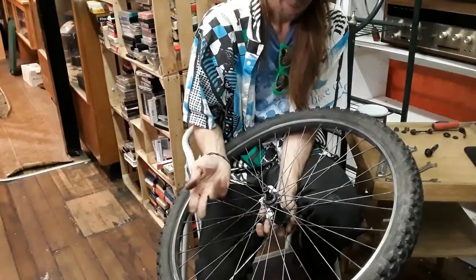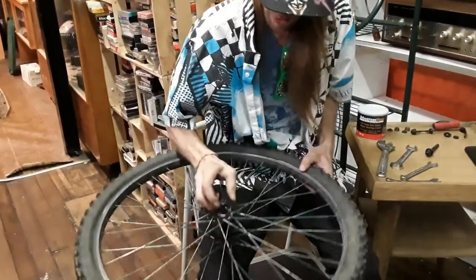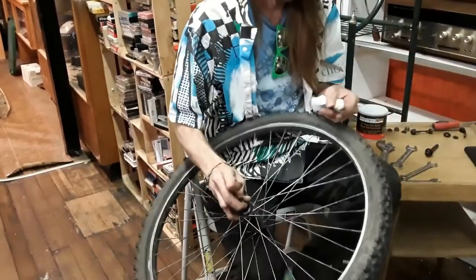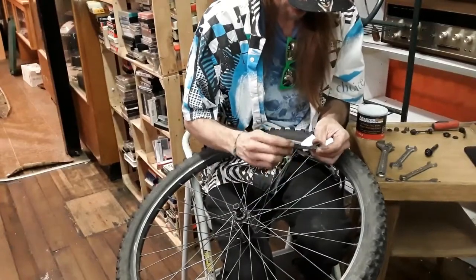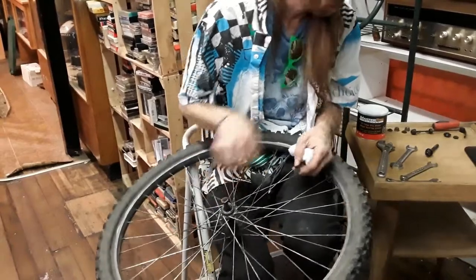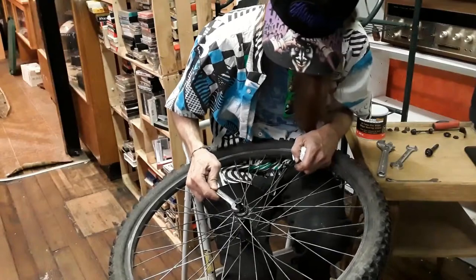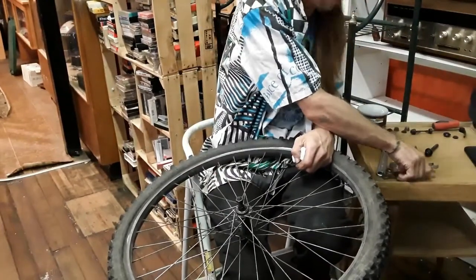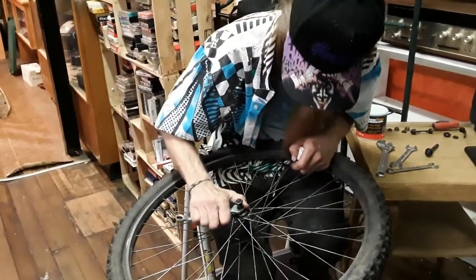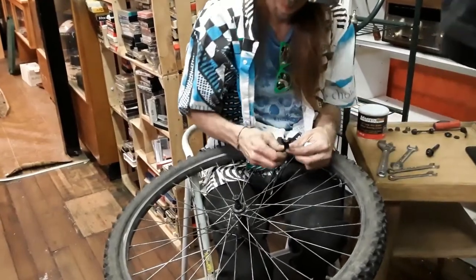So what size wrenches were there? I don't know what size the flat one is, but the top, this one happens to be 11/16 for us. They do vary. Does that have a size? No size. Looks like a 9/16. That might be closer to a half. Yeah, it might be a half. No. Metric? 12. There we go. It's a half. So you need a half and preferably a thin one.